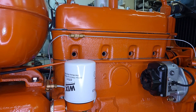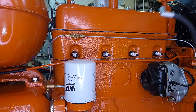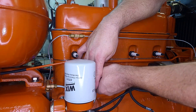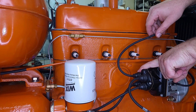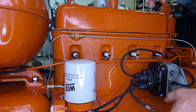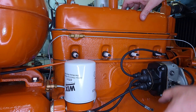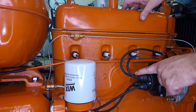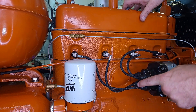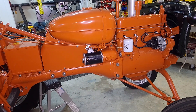All right, at this point I'll throw all the plugs back in. Remember, number one is the top left as you're facing it — the top one closest to the engine. The next one to fire is number two. Now the modern four-cylinder firing order is one-three-four-two, but this one's a little different. It goes one, two, four, three. So: one, two, four, three.